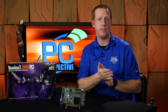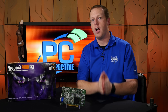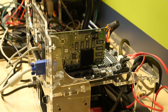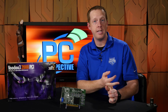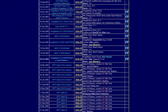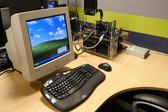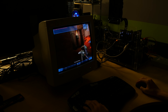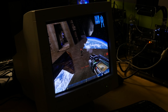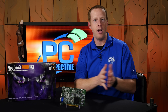Well, as you can tell, the setup process took a little bit longer than we expected — it's a different day and I'm wearing different clothes. But the good news is we did get the Voodoo 3 2000 PCI up and running. There were a handful of hurdles: we had to find a motherboard with a PCI slot — going back to Sandy Bridge — and find an optical drive to install Windows XP, which was the latest supported driver we found. The community kept building drivers for quite a long time, the most recent one I think was in 2007. We installed an ISO of Unreal Tournament Game of the Year Edition from 1999, it installed very quickly because we had it hooked up to an SSD, and it ran right out of the gate with no issues. You could run it at 800x600 or 1024x768, and it played very well as you'd expect.